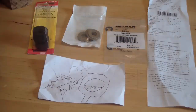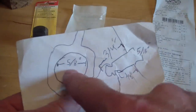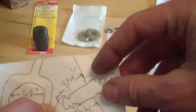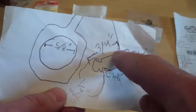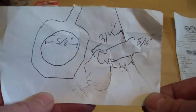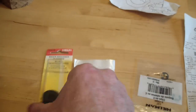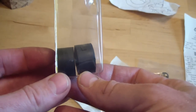Here's the detailed schematic and parts list. I measured it out: the hole on the inside of the white plastic thing is 5/8 of an inch, and the pin itself is 5/16 inch wide with a quarter-inch indentation, and it's three-quarter inches long. So we need a piece of rubber close to three-quarters of an inch with enough space for a couple of metal washers on either end. What I came up with was shock absorber bushings, which are a little wider than I need so I may need to shave them down, but the inside hole is just about right.